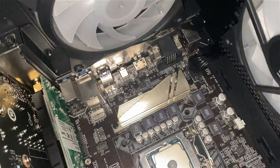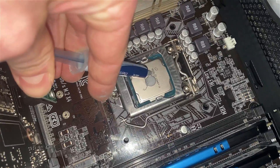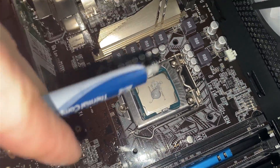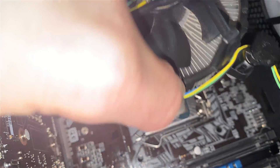Because it's not fully centered I might put just a tiny bit more to the left. If it overruns just a tiny bit it's not a big deal — I'd like it not to, but if it does, the paste is non-conductive. Now we're going to line the cooler up.